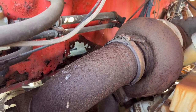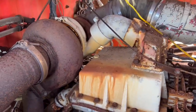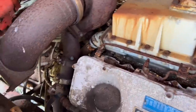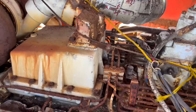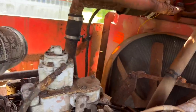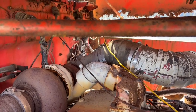Better be with a hole through the firewall. We will lose the heater matrix — that'll get relocated. I'll probably put a little diesel heater in the back, just in the sleeper cab. New injector lines. Remove the intake top hat, give it a clean, cleaning the valley out because that's full of bits of hood. Nice big project. Didn't need it, but here it is.